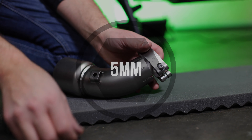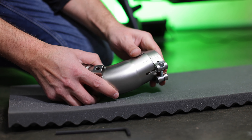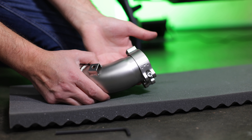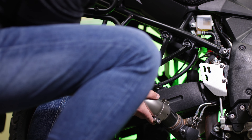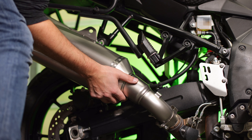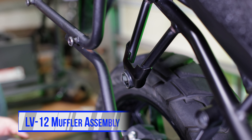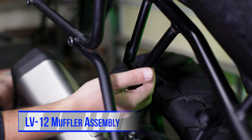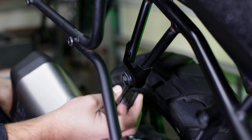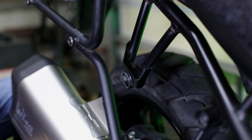When you place the clamp, make sure the bracket faces outward toward you, and also ensure the allen key bolt — which is a 5mm key — is facing outward as well. That way when you go to tighten it you'll have full access to the bolt, and it won't end up on the inside of the bike where you can't reach it. We've slipped the muffler on. For the frame bracket, remove all the hardware from it. You'll also notice a rubber bushing inside — remove that too. A little graphite grease can help it slide out.